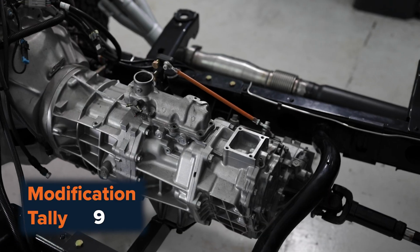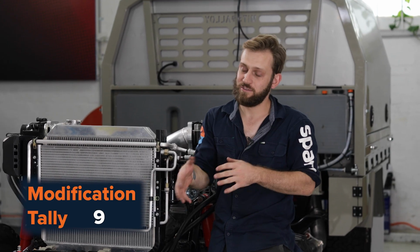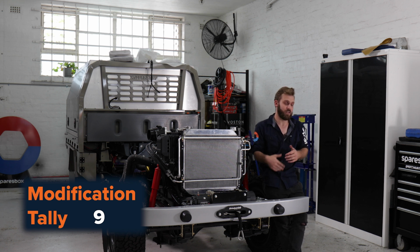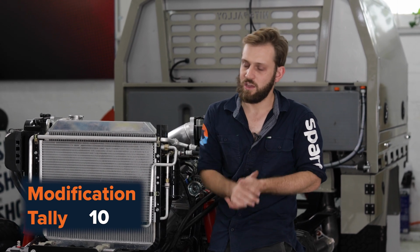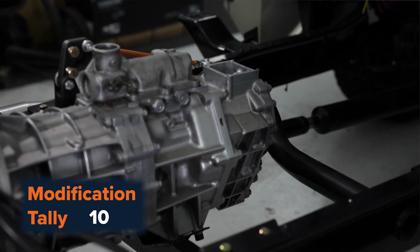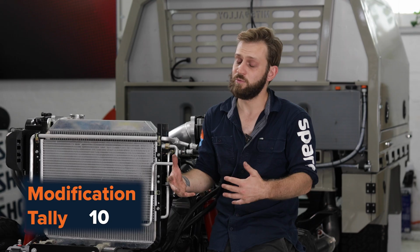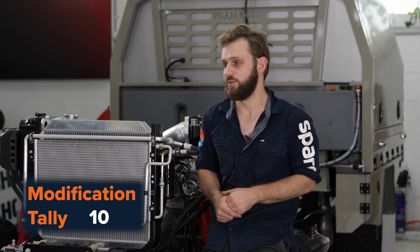The reason we went for that is it has the correct offset transfer case, as we are retaining standard front and rear FJ40 differentials, although they do have true tracks in them now, front and rear. So I wanted a dual offset transfer case. I wanted something that I could buy an off-the-shelf bell housing adapter from Castlemaine Rod Shop. So the R151F shares a bell housing pattern with the R154 Superbox, which meant I could buy an off-the-shelf solution.